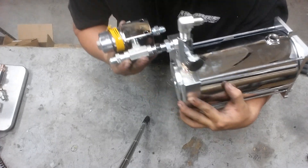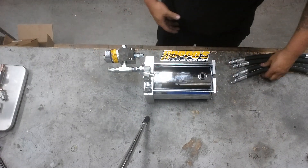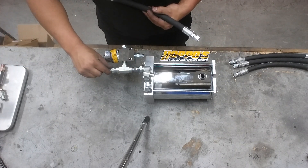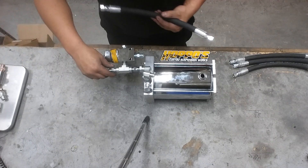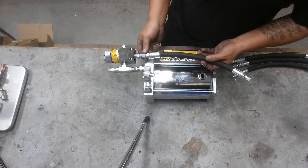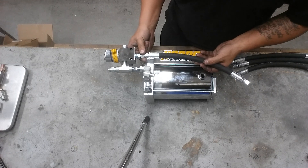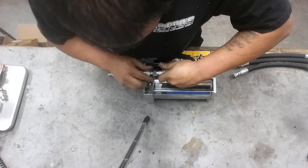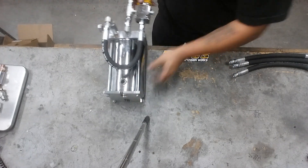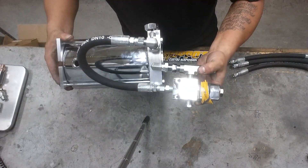So this is how it's going to look: slowdown and dump. Remember, your oil is going to come out through here — it's going to free flow. This is going to be your main line to your two cylinders in the front. Or if you guys are doing front and back, this will work for front and back as well. Then your slowdown — or your return hose — is going to get connected into the return. A lot of guys get intimidated by this section, but it's not that bad honestly.